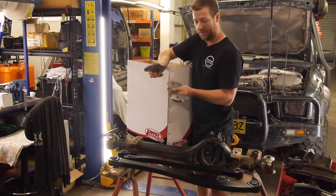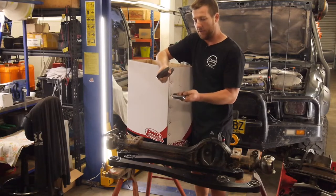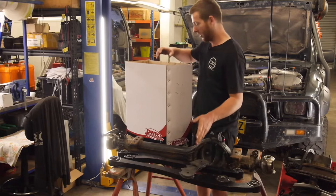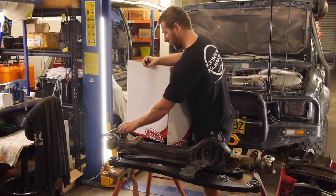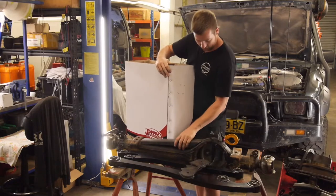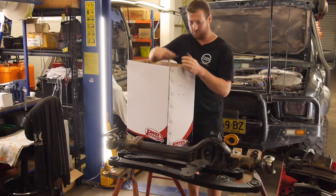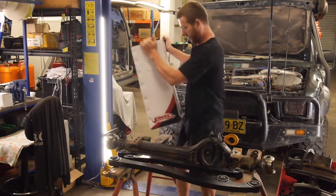He's also given me some brackets for the 80 series that locate on the diff, with cutouts to set caster and everything — just for mock-up purposes. I'll probably have to redraw some to suit once I've got everything tacked up. Matt said he'll get them recut for me. Obviously bolts and hardware, some gussets for the swivel hubs, a diff truss, crush tube for any through-holes in the chassis, shock mounting tabs — basically everything I could think of to get going.